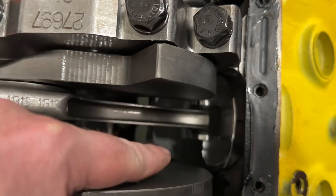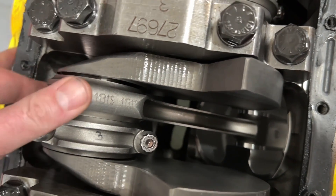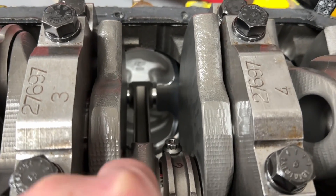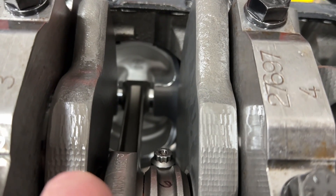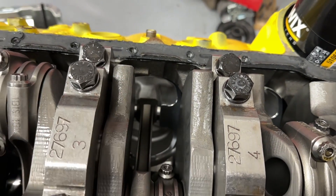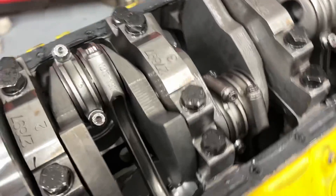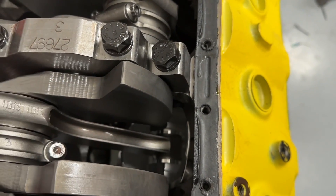So because it's piston-guided — guided by the piston — the rod stays in about this place. You might say it looks like you're moving it a ton, but that's because the cylinders are cold, nothing's warmed up, so it looks like it's got a lot of play. Really what's happening is it's not the rod moving so much — there's only 6 thousandths clearance between that. It's the whole piston rocking back and forth. Once things are up to temperature, these are nice and aligned. This actually frees up horsepower because the rod and piston is much more guided, so it's not trying to cock the piston and unseat the ring.